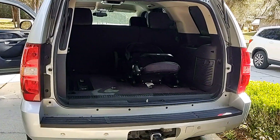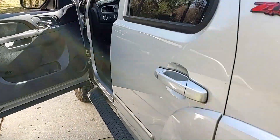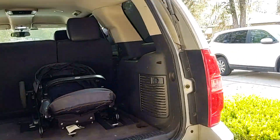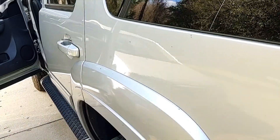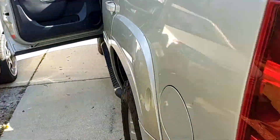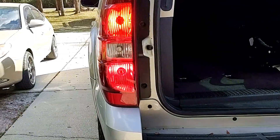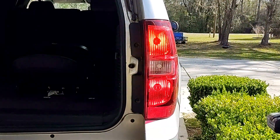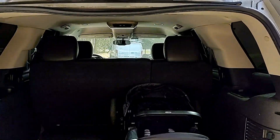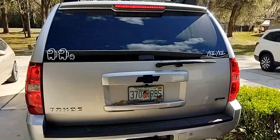Now I've got both modules installed on both sides. Turning on the running lights — as you can see, both sides dim, both filaments, both bulbs. Turn signal test — flasher on, both bulbs go full brightness with the turn signal. With the brake applied, as you can see they alternate with the mirror. Both bulbs are now handling turn signal duty, but that's why they have the third brake light.